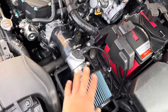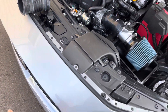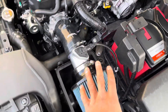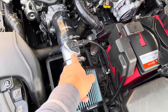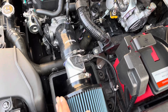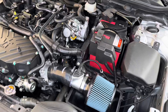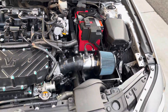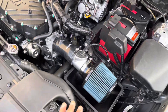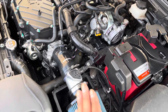On a dyno we saw more power with this intake because we didn't have forced floor air. Restriction-wise, this intake flowed better just sitting still. On the road, the stock box more than likely flows more because air is forced in and can't escape through the open holes. I've talked to numerous customers — around 300 — and they all reported the same thing: flow is better up top with the stock box because it has that resonator and all that stuff to keep air going in one direction.